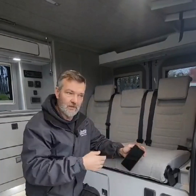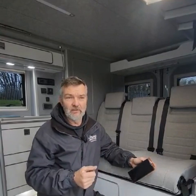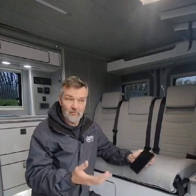You imagine you've got 100 amps to play with, and you can divide that 100 amps by whatever equipment you're using. The fridge is the biggest drawer — that can sometimes pull 4 or 5 amps on a hot day, an hour. Once you divide all your items by 100, that will give you a run time of all your appliances, which is not that long. In hot conditions you could be pulling 20 amps an hour, and that's why you need hook-up.